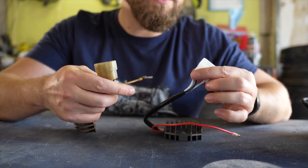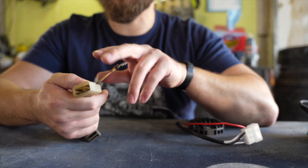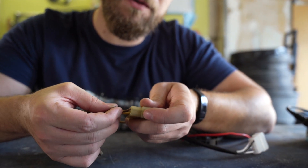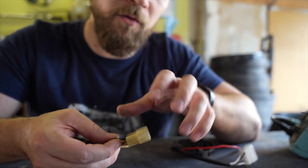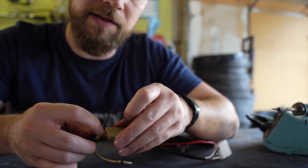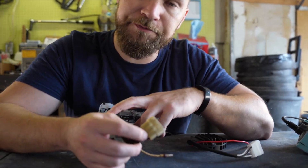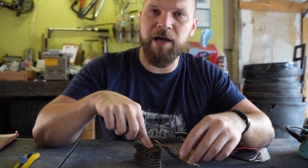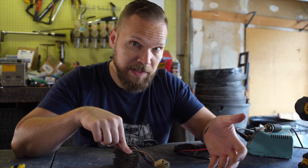These connect to the battery. You'll notice I have four plugs here and five plugs here on the factory circuit. There's a brown wire which is a sensing wire, so this is going to be hooked into your accessory circuit — a voltage reading from the voltage going to your accessory circuit. The way this works: you have AC voltage coming in three phase, so you have an AC input here, an AC input here, and an AC input here, and then the rectifier combines these waves into a direct signal, blending the pulses into a strong constant signal. Batteries are typically 12.5 volts and a charging system will bump it up to around 14.